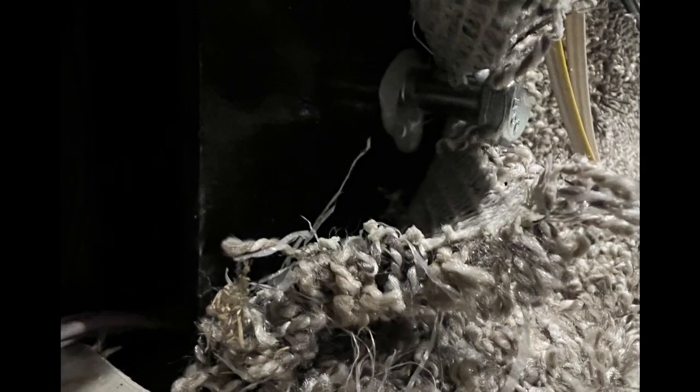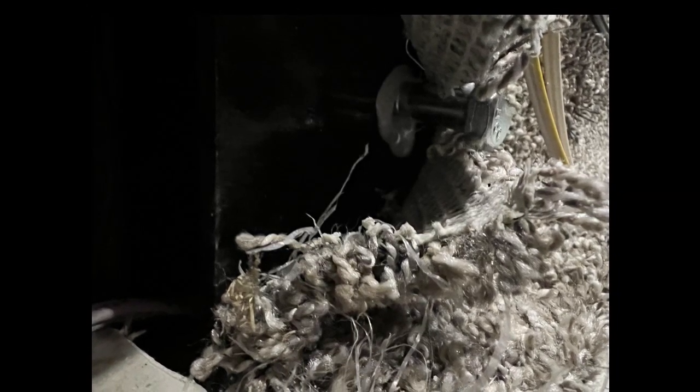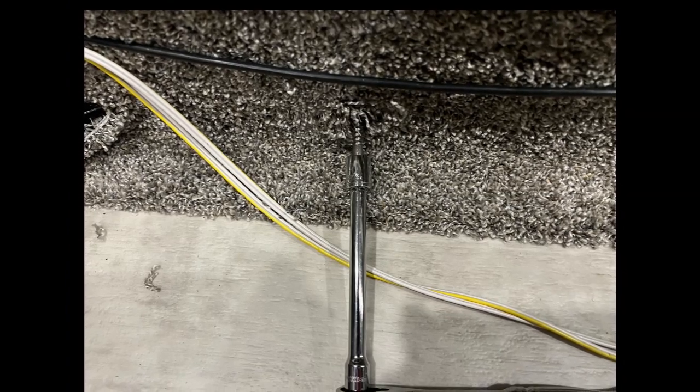The first bolt I mentioned is about two to two-and-a-half inches back. I removed it, pre-drilled the hole with a five-sixteenths bit for the half-inch bolts, put the sealant on the threads, screwed it in, and tightened it by hand with a ratchet. I don't recommend using an impact wrench — it's a tight enough fit that some sealant comes out around the washer and head of the bolt, and that extra sealant helps keep the bolt from vibrating loose in the future. I cut an X with my razor knife over the bolt and pulled the carpet back just enough. Most of these bolts are hidden under the bed, and when you tuck the carpet back against the bolt, you can't really tell it's been cut.